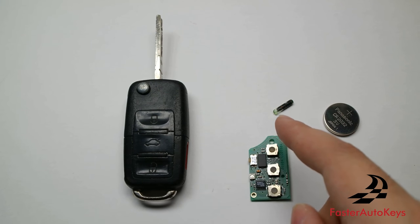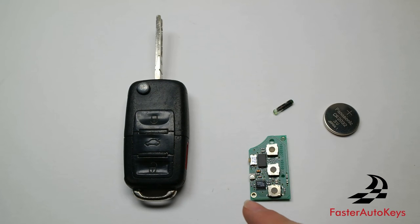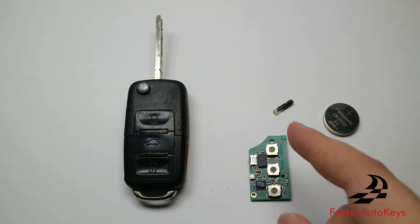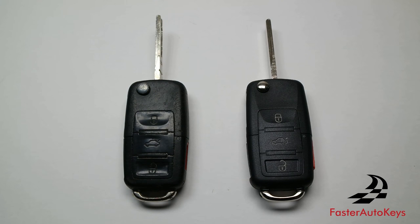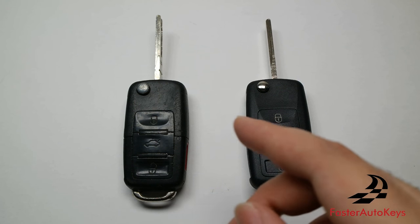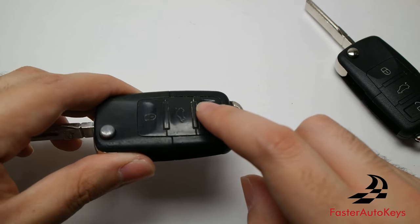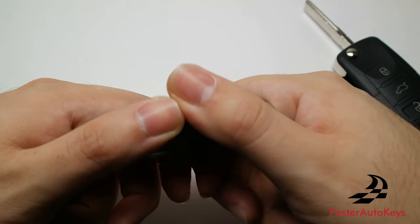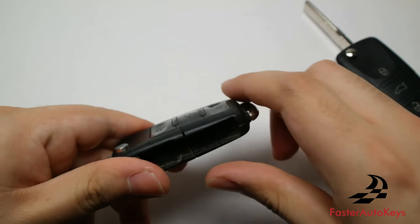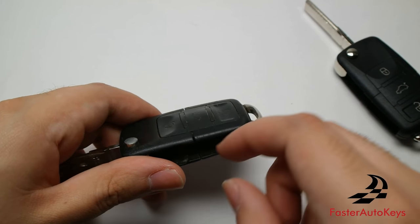If you're only going to change the bottom part, this is a very easy tutorial, and it will be a little harder if you're trying to change the top part that includes the transponder chip. First we will change the bottom portion of the key that has the keyless remote and the battery. The first thing we need to do is separate the top and bottom half on both keys. If you've ever changed the battery before, you're probably familiar with this step — generally you can simply pull it apart, or use a flat head screwdriver to push the two halves apart.